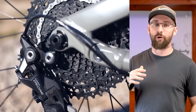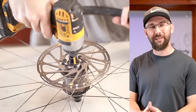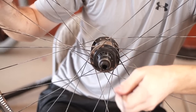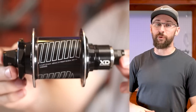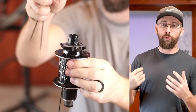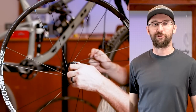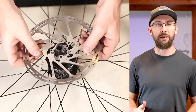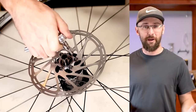In order to make a tricked-out 12-speed cassette work on this Mythique, I gotta change the rear hub. Luckily, Mr. Dentist threw in an old 28-hole rear wheel that would work on this bike, but it's a 29-inch wheel. So that means de-spoking yet another wheel and lacing up a new one. I can't use the WTB rim that came with the Mythique. I picked up a 28-hole DT Swiss 27.5-inch rim off eBay for $87. This wheel was the easiest wheel I've ever laced. I think it's partly because it's the first time I've ever used some high-quality DT Swiss parts, and I still have not purchased a truing stand after all these wheels I've laced up. I just flipped over my bike and used that as a truing stand.